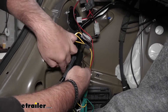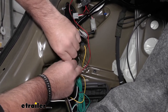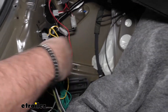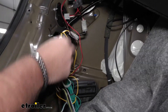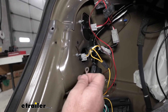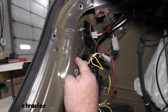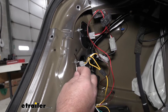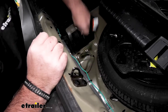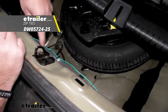I'll take the other one and go around the wires right down here at the bottom. Then we need to mount our ground wire — you just need to make sure it's on metal. You can use the self-tapping screw and drill a hole here, or I'm going to use the tail light nut here since this whole thing is metal. I'm just going to take that nut off and ground my ground wire right there. Right on my four-pole wire, down by my spare tire, I zip tied the green wire to this factory wiring.